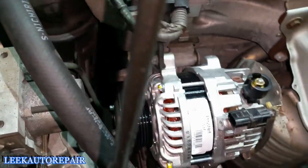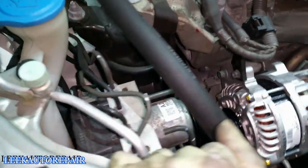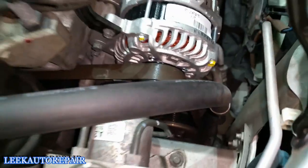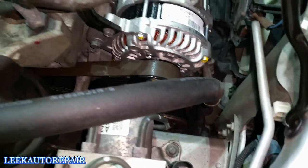Now I've got that on, so I'm going to get the belt back on. I left the belt in place so it should be easy — just line everything back up in the groove. You need two hands for this. I'll be doing a separate video on serpentine belt removal. I got my belt back on. It was pretty easy because I didn't remove the whole belt — I just moved it out of the way while the other pulleys, including the AC compressor, still had the belt looped around them.